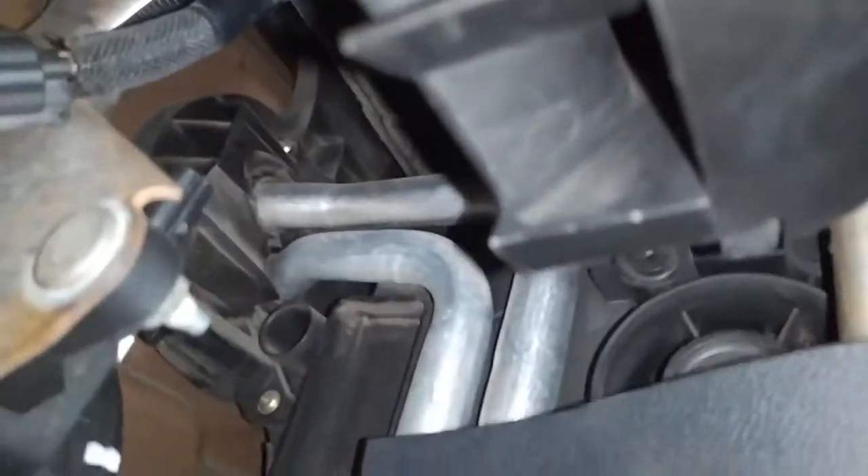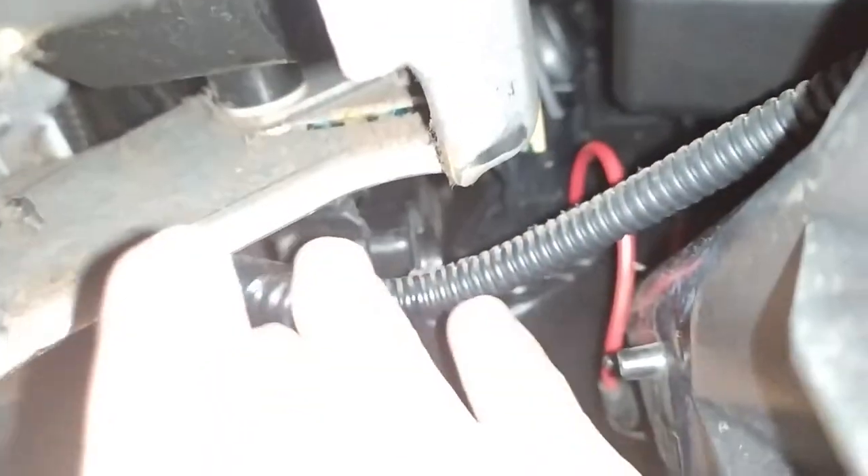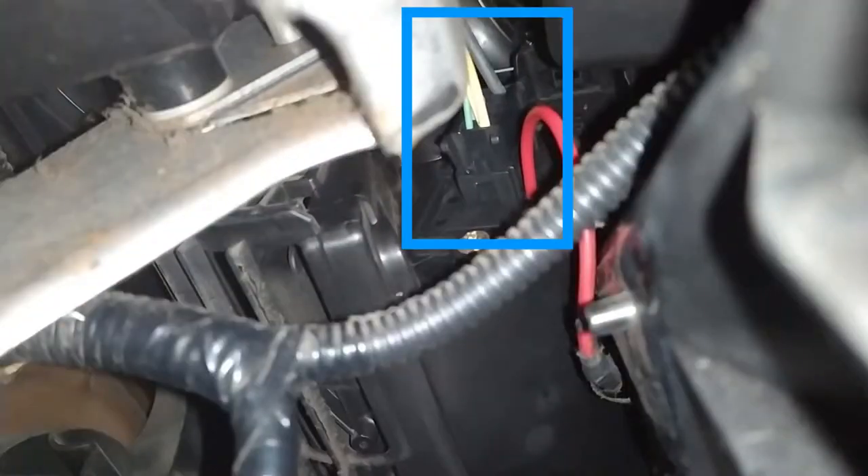The second thing you want to check is the wiring harness. Most of the times the harness is the problem. My car has the left steering wheel, so the harness will be located right here. Below that harness there is a resistor that gets really hot, especially if you use the low settings on the fan — that is burning the connections. You want to disconnect it and visually inspect it for any burn marks or melted connections. If there is nothing visible, you can start the car, turn on the fan, and very carefully wiggle the harness. If the fan starts, then you should consider changing the harness. I will leave a link in the description with an instructional video on how to change the harness.